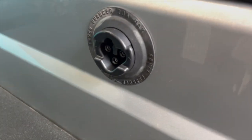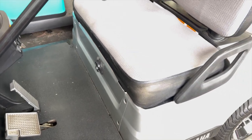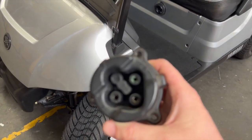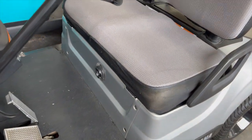So what we've done is gone ahead and fitted a replacement receptacle here, and now the vehicle's charging perfectly — there's no problem. It's charging exactly as you would expect. All we did was replace the faulty receptacle. Thanks for watching, please like and subscribe for more videos like this.